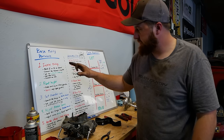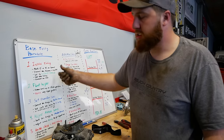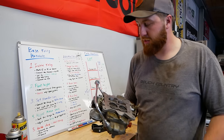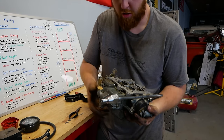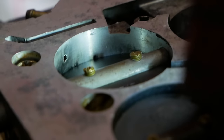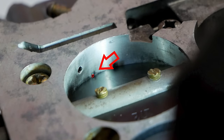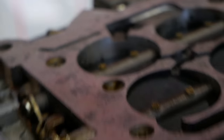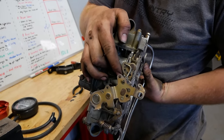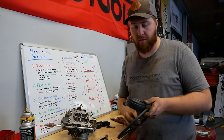Let's set our transfer slots. The first three steps can be swapped around depending on what gets your car running. I know Luke likes to start with transfer slots — you flip the carburetor upside down, push this little red lever up for the choke, then come in here and set your transfer slots to a square. When I say transfer slots, I mean that long rectangle there. I want to set that blade until only a square shows. You can take the carburetor off and set it manually with the curb idle screw, or use a vacuum gauge and leave the carb on the vehicle.